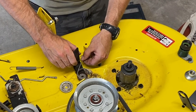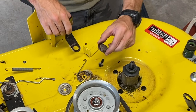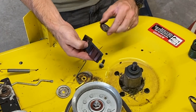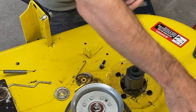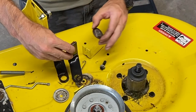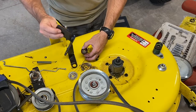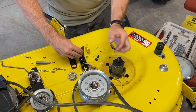This piece is separate — it goes on top, you have a spring, and you have this bottom piece. There's my old brake — it was almost ready to start rubbing into the metal. So the new one will go like this: put the brake down first, then the spring on top, then put this top piece on.